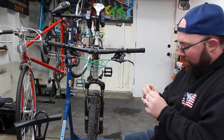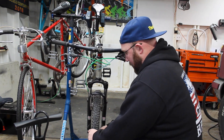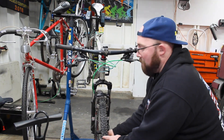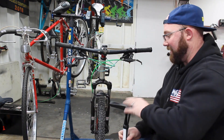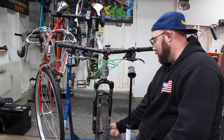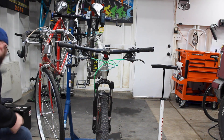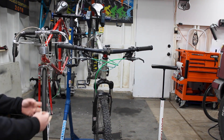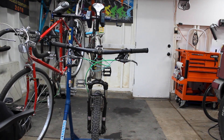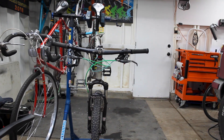We got all the air out of our tubes. We're going to throw our valve cores back in to the fronts and fill them up with good old bike pump air — fresh air to start with. We'll fill the mountain bike front tire to 35 PSI and fill the Galaxy front tire up to 80 PSI. We'll tighten down the valve core and cap on the front tire, then move on to the backs for CO2.